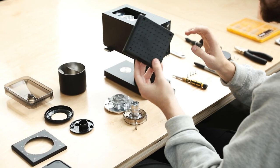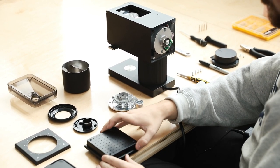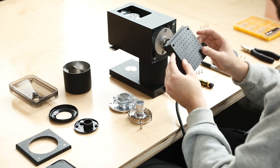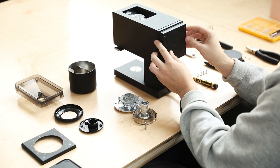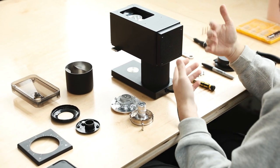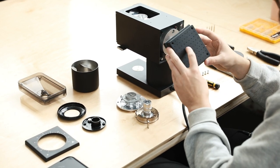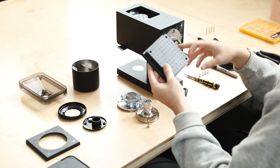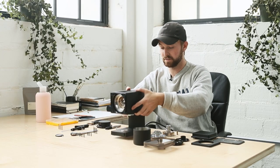This back plate is plastic - it would be nice if it were maybe a higher-grade plastic. The markings inside say ABS, and it would have been nice to see something metal. Being on the back you're not going to touch it as much, so overall that's kind of nitpicking. It will protect the grinder from falls if it were to tip back. Also, the lack of cooling holes may have been intentional, because holes of that size could allow particles to get in - you want this to be a closed system.